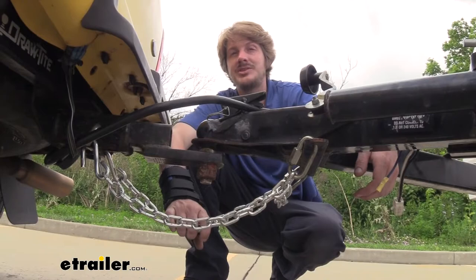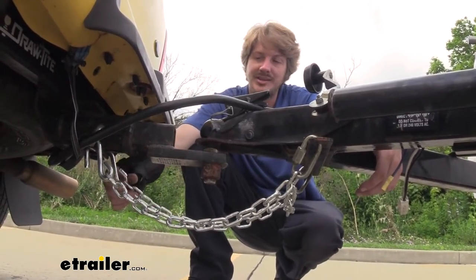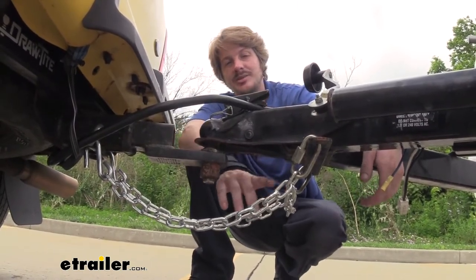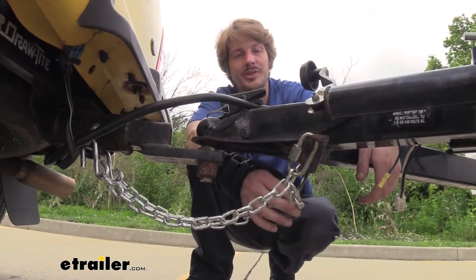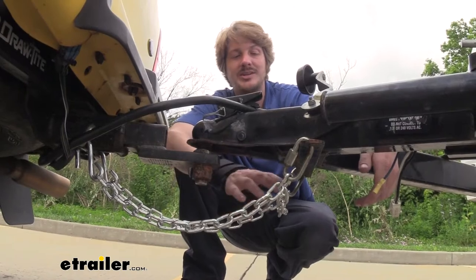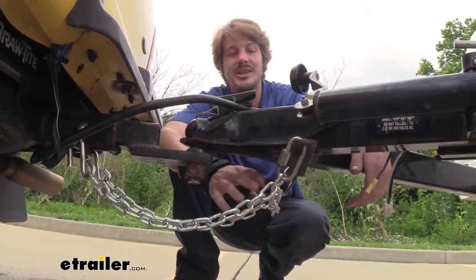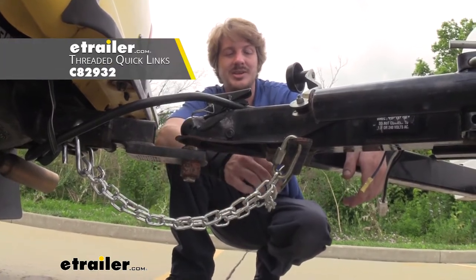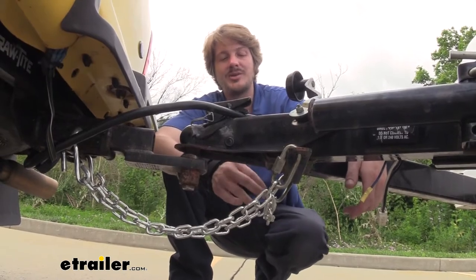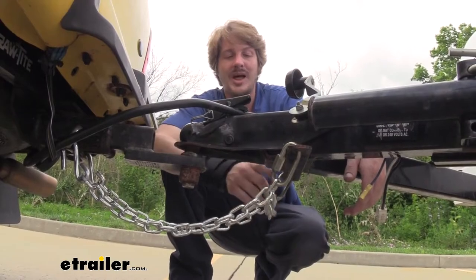This is an all-in-one safety chain solution for your trailer, so you're going to get one chain that has S-links on each side and it's designed to take the center of the chain and attach it to a single point on your trailer. You can either weld the links on, bolt it in place, or use D-links — which is what we used today — to attach the chain. You can get these quick links at eTrailer and I highly recommend them, as they make hooking safety cables to your trailer a whole lot easier.